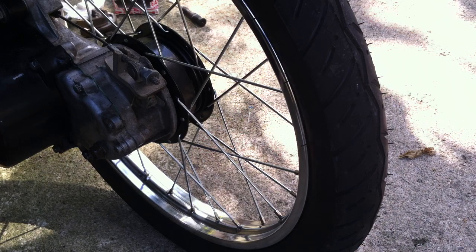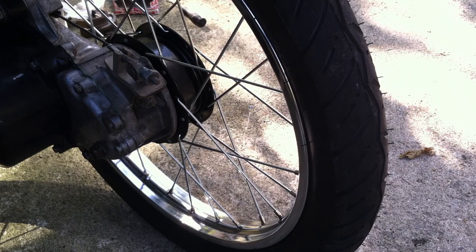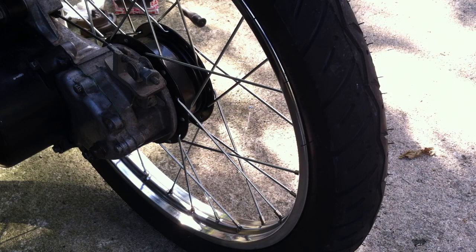So I did the 16-inch rear tire on the stock engine with the MLM circuit pipe. I had to go to the 9325 belt to get the pipe to hit again, which is smaller than the stock belt. And once I did, I only gained about a mile an hour or so. So I could continue to futz with that, but I just don't think the engine has the power to really take advantage of that rear wheel. The rear wheel is basically creating too tall a gear. Maybe I could squeeze a couple more miles an hour out of it, but we're just going to stick on.